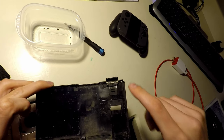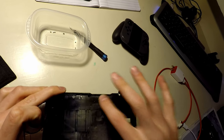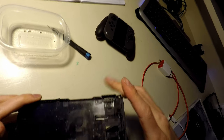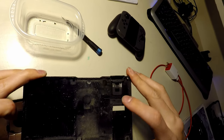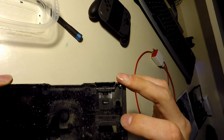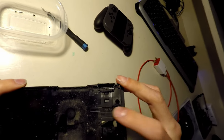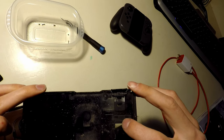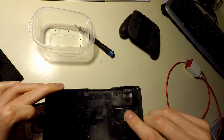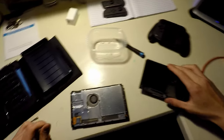A little bit of a tool and die experience in my background here, so I like looking at this kind of stuff. Injection molding. It looks like replacing this is going to be pretty easy too. There's a couple of screws there, so we'll get to that. That's a PA GF55, PA. I'll have to look up what PA is. PA6 is glass, is a nylon. Well, actually, no, this is a nylon. It's just not a 66 nylon, so it's a glass fiber, 55%. Okay.